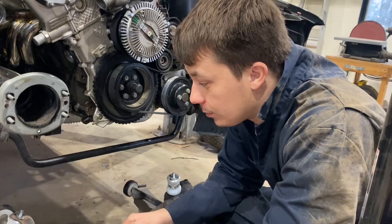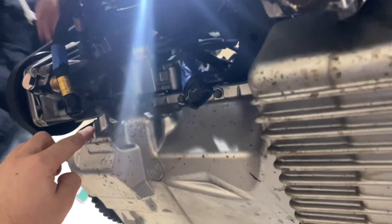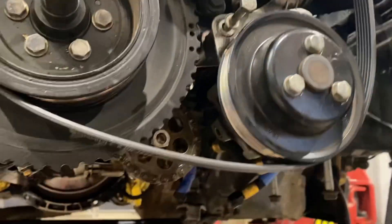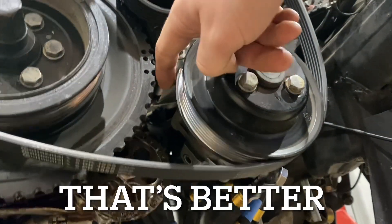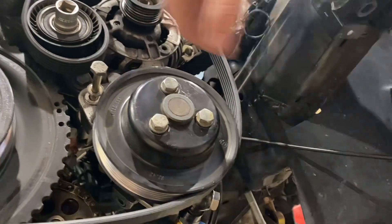I also feel really bad for you if you have to do this without a lift — still doable, same steps, good luck. Now that the subframe and everything is out of the way, we can drop the pan. There are 10mm bolts all around the pan, and you also have to take out this bolt for the power steering. To pull the pan — at least for the S52; not sure if it's the same for the M52 — this power steering pump will hit right up in here. So you're going to take this bolt out, kind of swing it out of the way. You'll need the belt off too, so belt loose, bolt out, swing out of the way, then you can drop the pan.